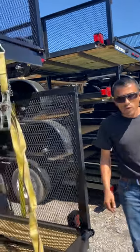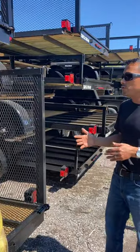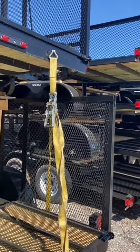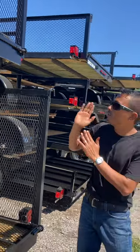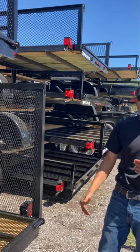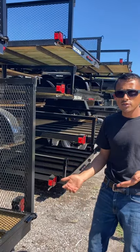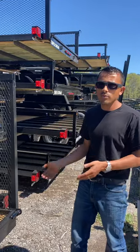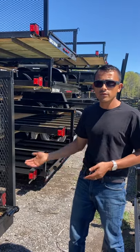The same formula would work — strap a single strap here and a single strap on the front. If you feel that your load is not secure enough, go ahead and add another strap to the side. You could also run a strap all the way from the front to the back of your trailer. That's my presentation for this video on how to fasten your trailer load properly with Triple Crown from Savannah Trailer.